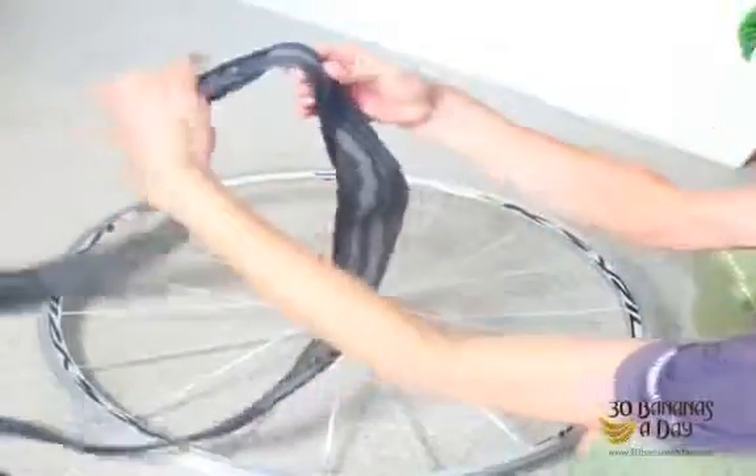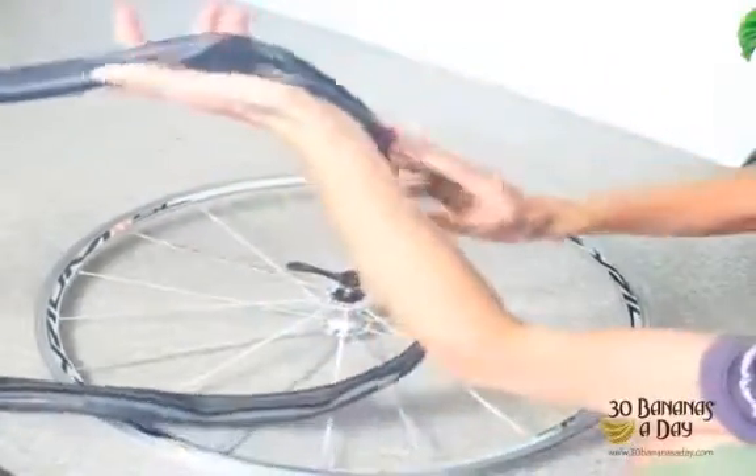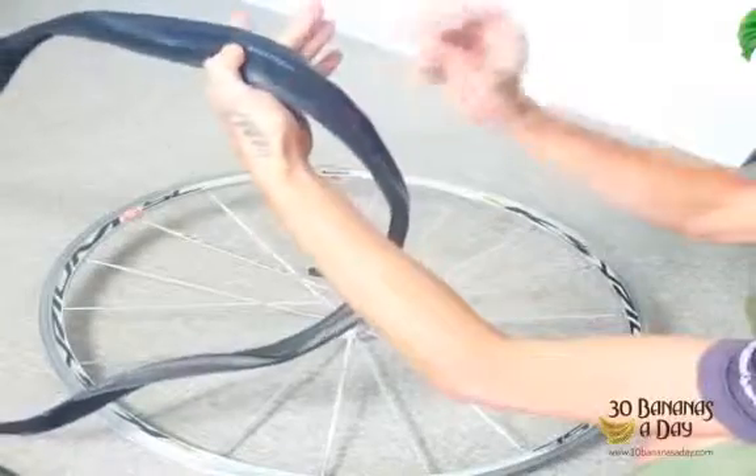What we've done is we've checked the tire for a piece of wire or a piece of glass. We've turned it inside out and just run our hands gently around the tire. If you find a bit of glass, you pull it out and put a patch over that if there's a big hole.